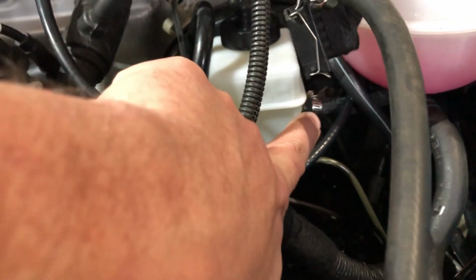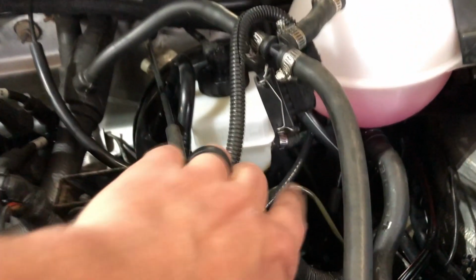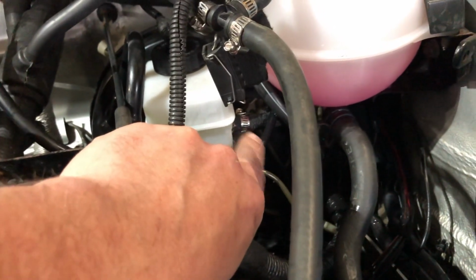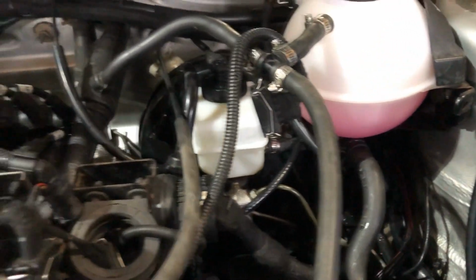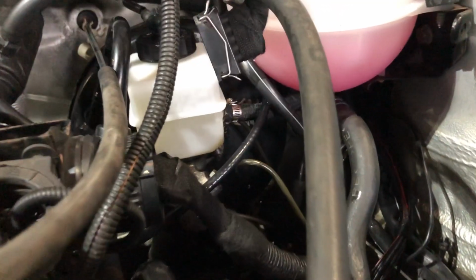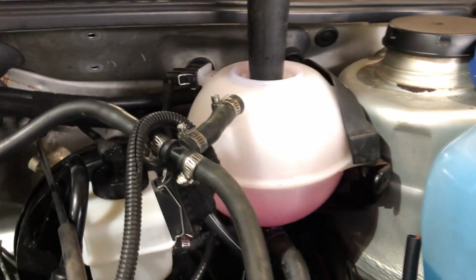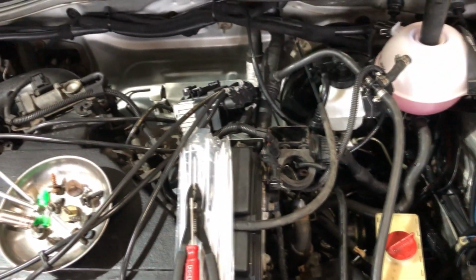And it was this clutch line. A friend of mine gave us hose, but apparently it's not brake line safe, and it was just seeping out. So I bought this stuff off Amazon. It's like BMW, Volkswagen, Audi clutch master cylinder feed hose. So that's the brake reservoir that has a nipple that feeds the clutch master back in there, and that was leaking. And then the coolant was leaking afterwards, and it was just a giant escapade of slight drips that has taken a long time.